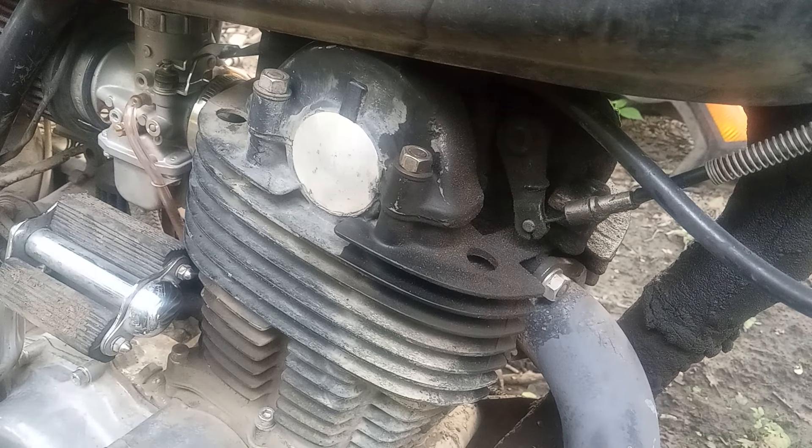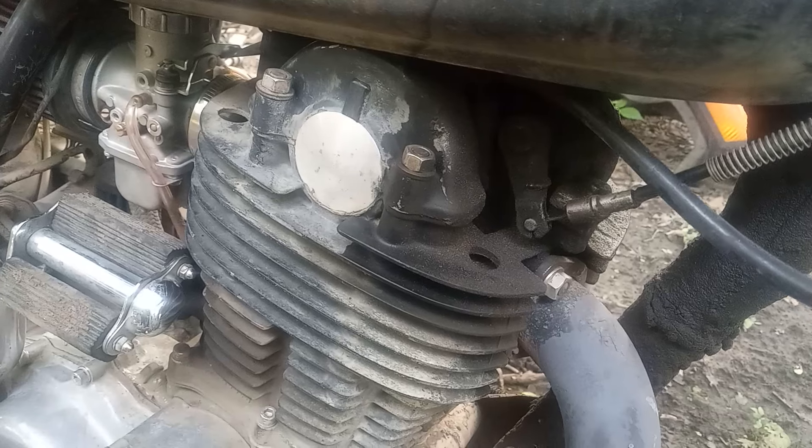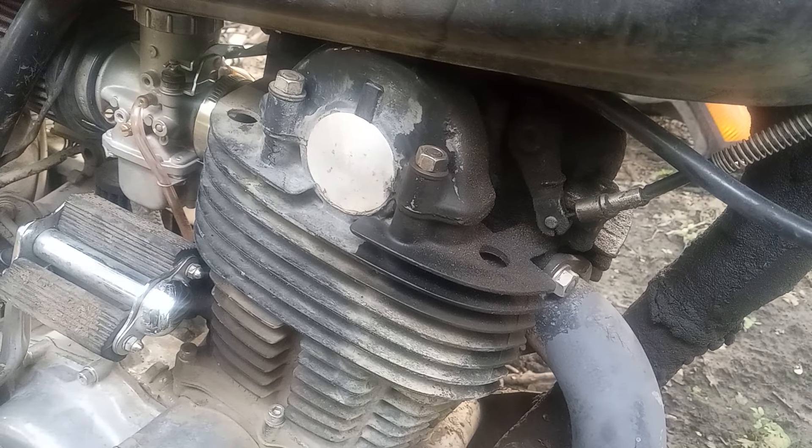On these bikes the electrical is fairly simple for the ignition — there's only one wire that runs up to the headlight that will kill the motor. The ignition is always on; it's a magneto like Briggs & Stratton has, except it's electronic. There's simply a kill wire, and I thought the kill wire must be shorting somewhere — but no, it wasn't. It was just decompressing.